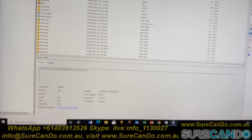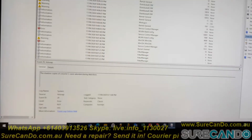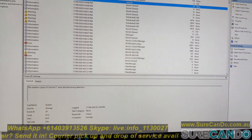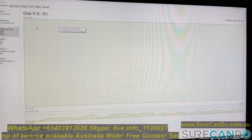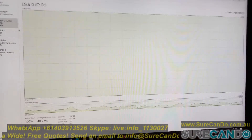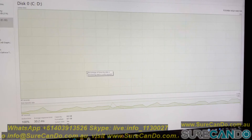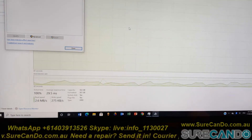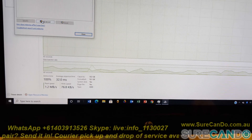But we don't have any more of those. It's just Windows fixing up, repairing itself after the cloning and getting things ready. This will eventually become normal — it's going to scan itself and repair the file system, etc. But we won't be doing this every time it restarts — it's one time only. We'll leave the computer on, and also leave indexing on.